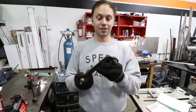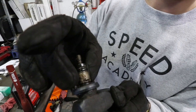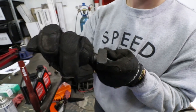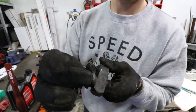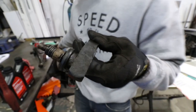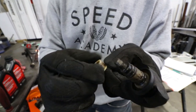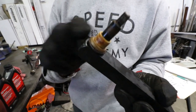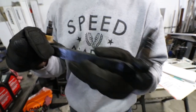Good thing I actually took this arm off, because the plastic bushing that holds it in place onto the transmission mechanism — which allows you to shift gears — is absolutely destroyed, and that's where most of the play is coming from. You can see on this side as well it's worn out, starting to wear through — this one is about to fail. This is what a healthy bushing looks like — that's the condition you want.